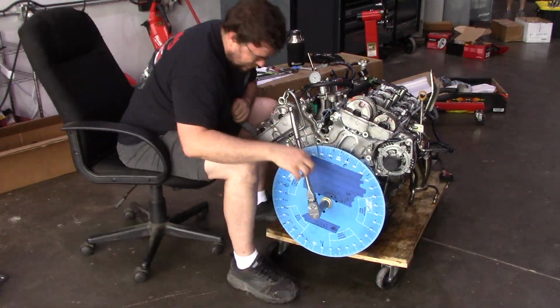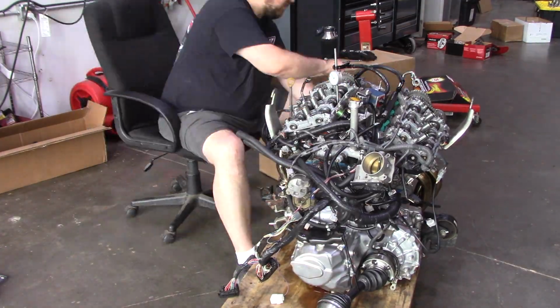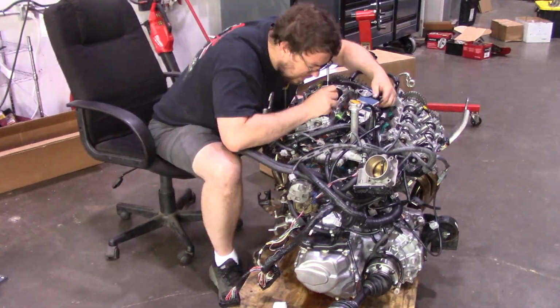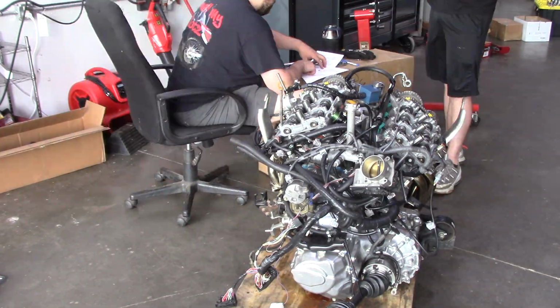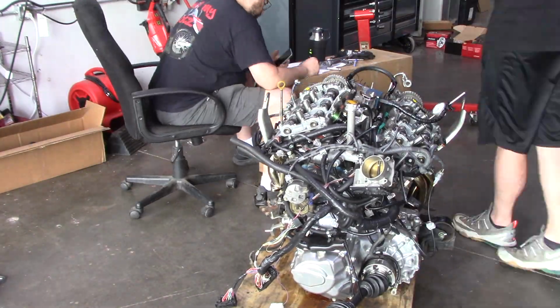The first one is the lift. The Monkeywrench Racing cams here have a base circle of 36.2 millimeters, which is reduced from 38 millimeter stock, with a 6.7 millimeter of lift at the cam. That means about 11.5 millimeters of lift at the valve, assuming zero lash. This isn't too far from the advertised 11.67 millimeters of lift, but it doesn't feel like a great number.